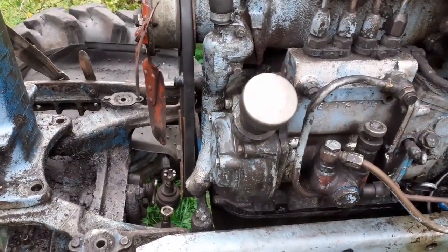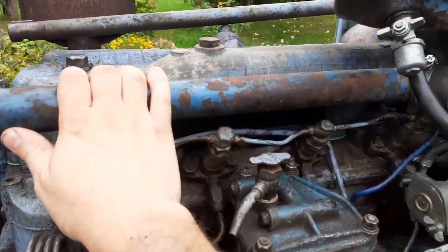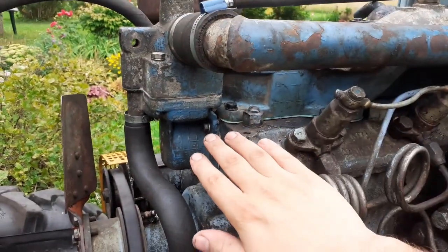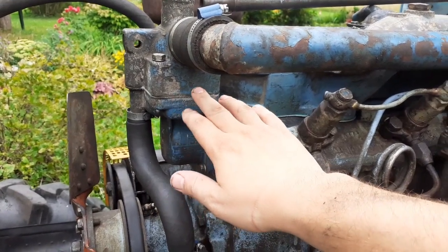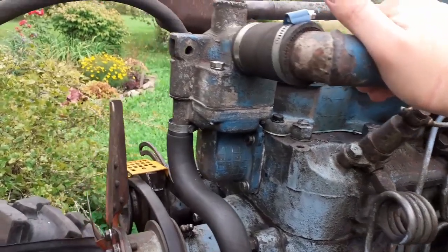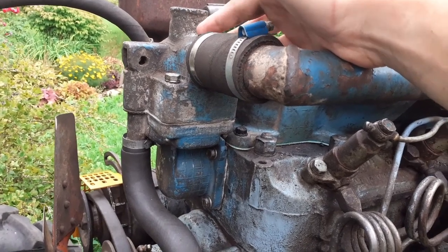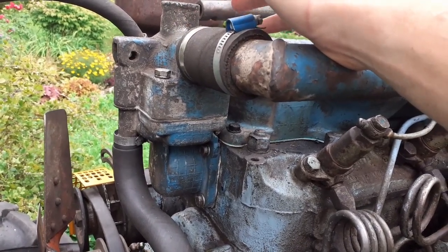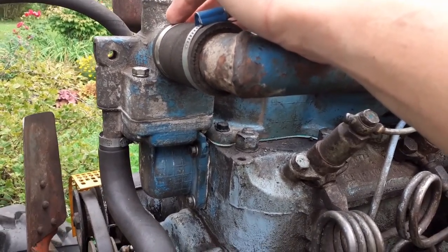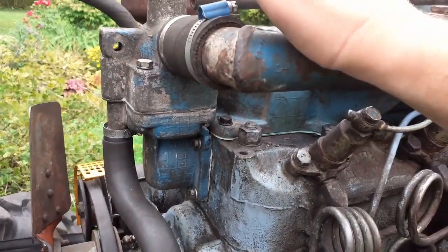First and foremost, I had to change a lot of things. I put a better used coolant tube for the starting engine. This engine, because it's a starting engine, has a different thermostat housing. You really want to pay attention to this — you can't buy this housing anywhere anymore. Usually they corrode and leak like hell. Hopefully this one is better than the last one.